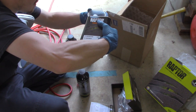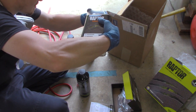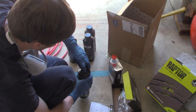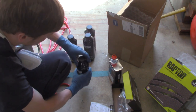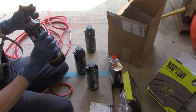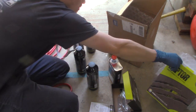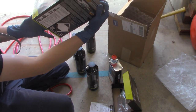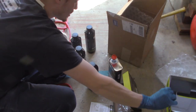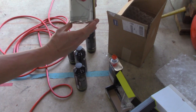Raptor supplies a measuring cup for the activator so you can add the perfect amount to your base coat. In this circumstance I only needed one bottle for this job, but for a frame you'd need a lot more. I looked inside the base bottle and it looked like a white chalky color — at first I thought I'd ordered the white kit by mistake. Turns out I ordered the tintable version, which you can make any color by adding a urethane paint. So I quickly ran out to NAPA to get some black urethane paint.